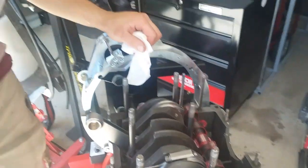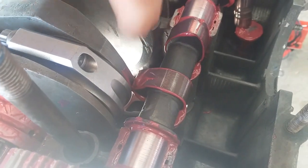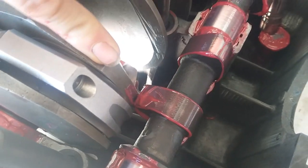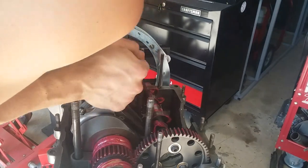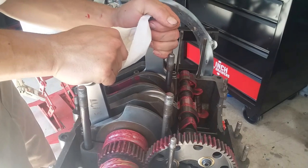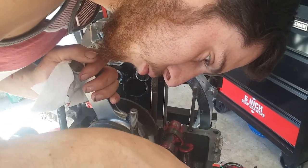So when we're hitting that hard spot, when it wants to stop spinning, it's hitting right there. We're hitting our cam on our crank. Our cam lobe is hitting our crank at the bottom of its cycle. So we need to clearance that crank just a tiny bit. I don't know how bad it's going to throw off balance, or if we can clearance it enough - we'll have to ask a buddy of mine a couple questions. No damage so far, but if you ran an engine like that I'm sure it would be damaged.